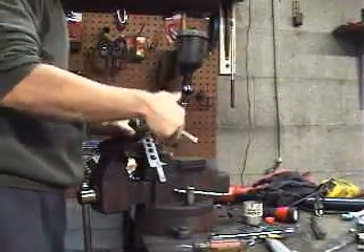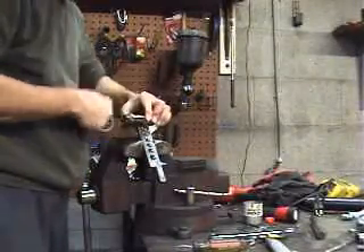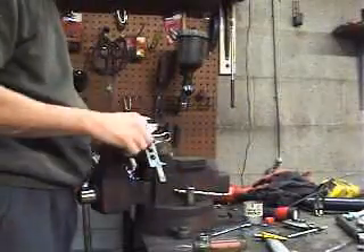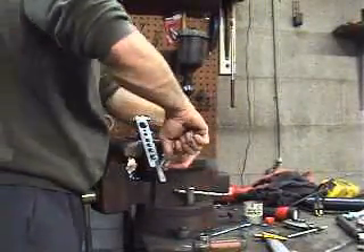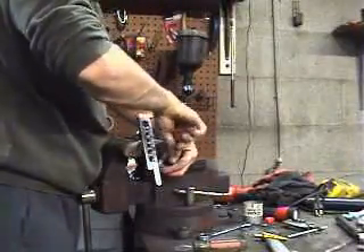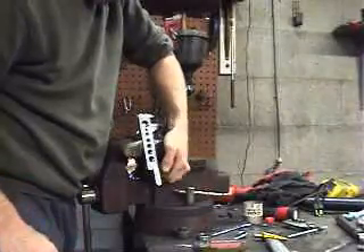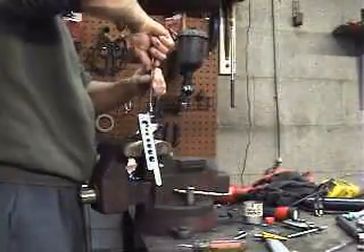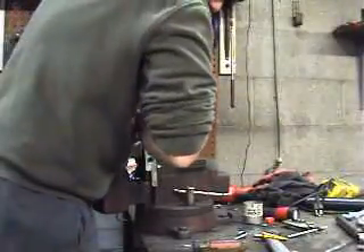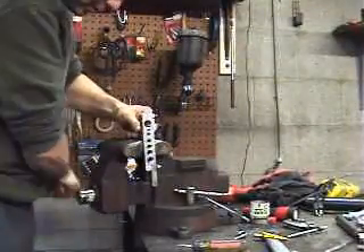Your flare — there it is. Looks like it turned out okay. Now it doesn't have to look like your perfect store-bought flare. As I've found, once you tighten these nuts up against the male end of the flare, I rarely have trouble with them sealing. It kind of shapes itself to the surface it seals to when you tighten the nut down — that's what happens.